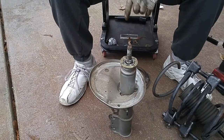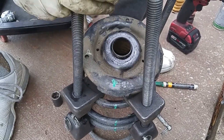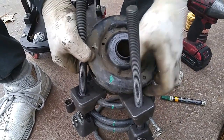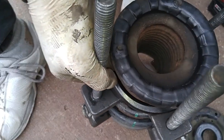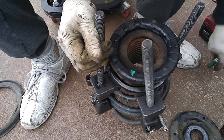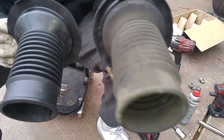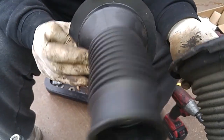But there's no rebound pressure, so all the gas out of this strut has leaked out. If you want to remove the upper spring seat to check the condition of the bellows, there's an arrow right here that we put a paint mark on, lined up with the spring, and now we can take the spring seat off. The bellows hasn't split or broken apart. If you think it could last the life of the next replacement strut, keep the old one — but I was able to get a new one at a discounted price, so I'm going to put on a new one.